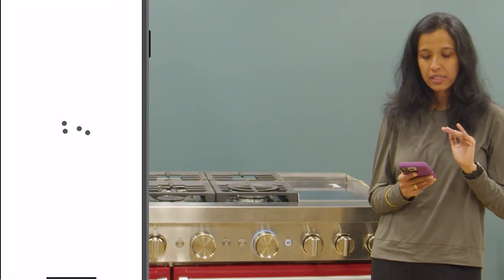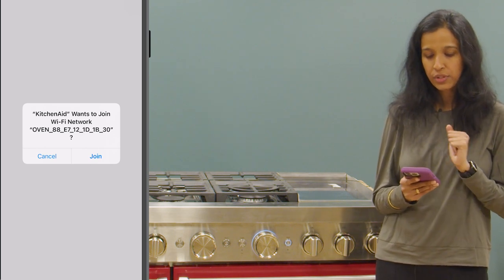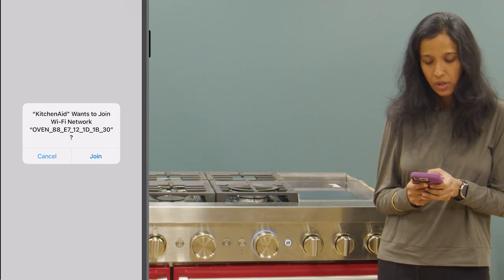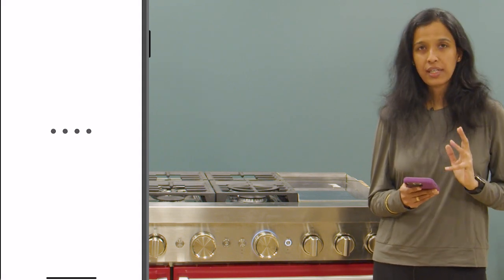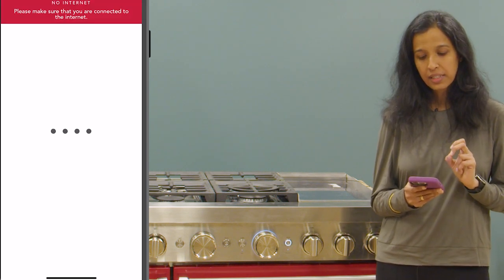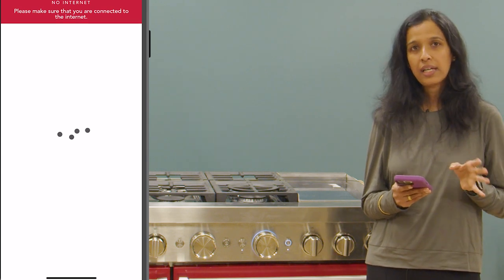In the next few moments the app will give a pop-up which says 'KitchenAid wants to join the oven network.' I got the pop-up on my app screen now, and on that pop-up we have to tap on the join option. If we have used the correct Wi-Fi password and the correct Wi-Fi network, in approximately two minutes this appliance will be connected to the home Wi-Fi router and to the KitchenAid app.